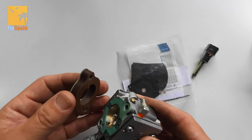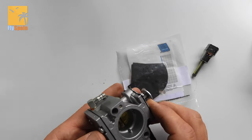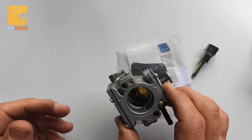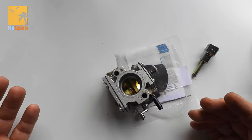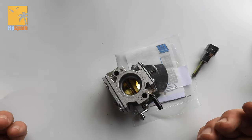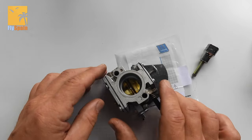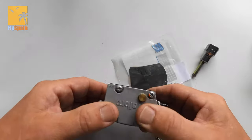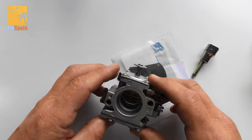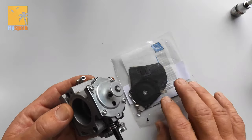The reason we are taking this carb apart and refurbing it is because the diaphragms inside have got a bit weak. This carburetor is about a year old, maybe a little bit more. What we're experiencing just before launch — your wing's ready, your wires are out, you've warmed up your engine, it's running — as you lean forward it cuts out. So as we're changing the incline of the carb as we lean forwards, the carb is cutting out, which is a bit annoying just when you want to launch and you've got a nice bit of wind.